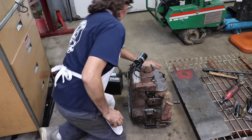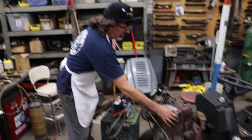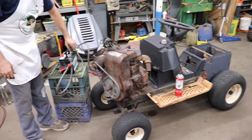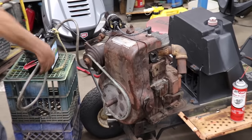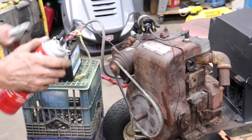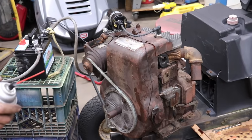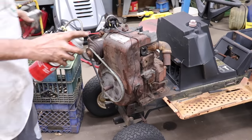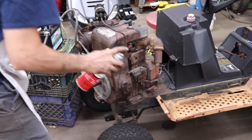Crank this thing faster. Well, now we got it mounted to our test frame. So I'm gonna power up the coil again. And I got a new battery from up front. It doesn't seem like it's cranking it any faster. I don't know, maybe the starter generator gotta be taken apart and cleaned and gone through. And I may have to do a valve job. Let's find out.